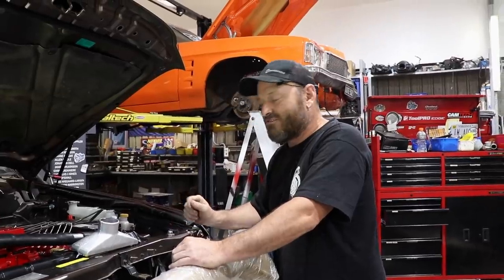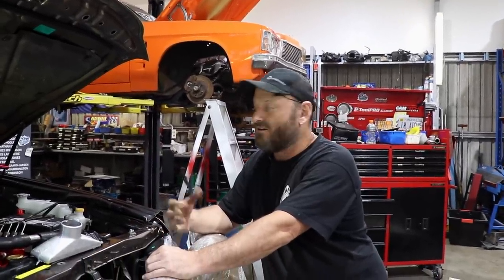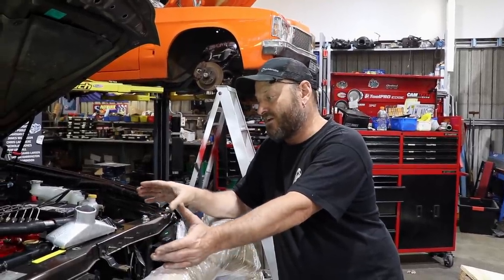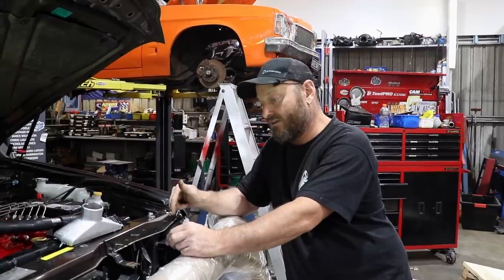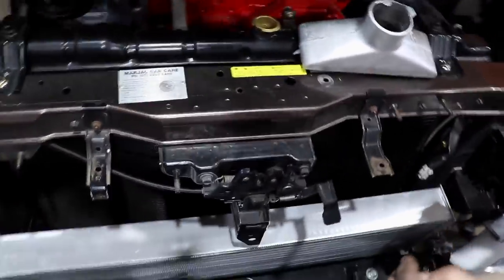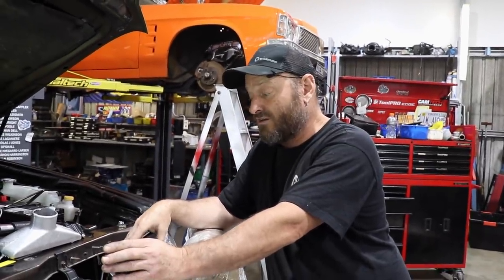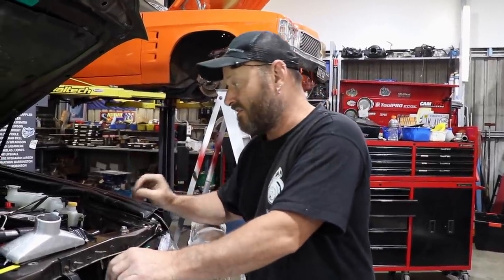I came up with this idea because not so much in a Cummins, but in a TD42 powered car, they're prone to overheating and you need to be careful of blocking the airflow to the radiator. Putting a normal intercooler like a 600 by 300 in there, you end up with a lot of tank blocking the airflow. So my idea was to get a core that was as wide as the entrance to the car, which is the 850. It's pretty much the same area as a 600 by 300 by 76 generic intercooler, so it's going to have the same cooling effect, but it's not going to impede the airflow through the radiator. So we'll see how it goes.